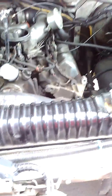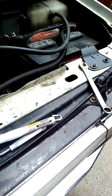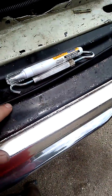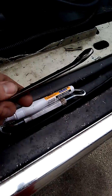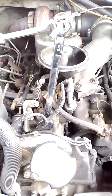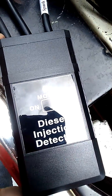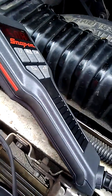What are you going to need? I've got white-out, a smaller turnbuckle — I got the turnbuckles from Menards — my custom 9/16th pipe wrench, which I ground down in order to get to the injection pump bolts, a three-quarter inch wrench, another longer turnbuckle, and of course my favorite meter, part number V765-01, and then a timing light with an advance.